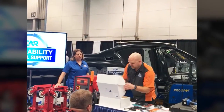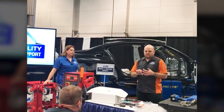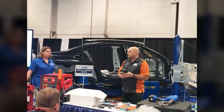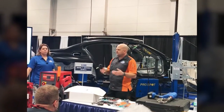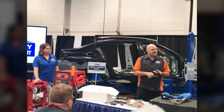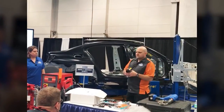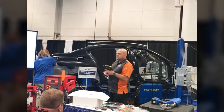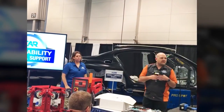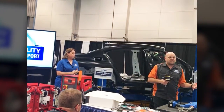This is the neutralizer AC. So how many people have had troubles maybe matching metallic colors in bumper covers versus quarter panels and fenders? That happens from time to time. Metallic orientation gets a little bit messed up. You get some dirt in some of those plastic panels as well. Static electricity in those bumper covers attracts dirt. So this tool can be used to get rid of that static electricity. It will help keep your paint jobs cleaner on the bumper covers.